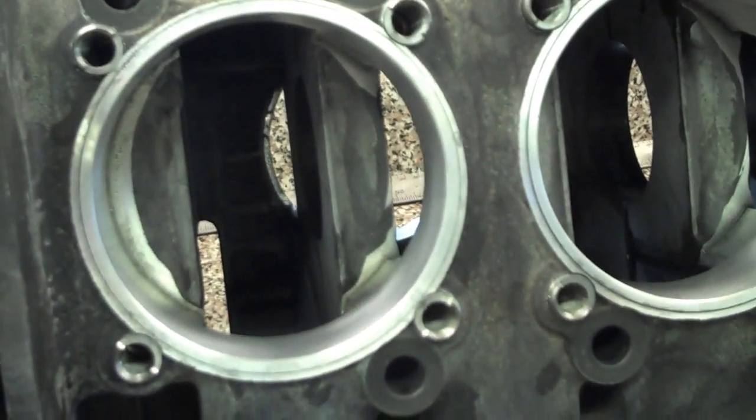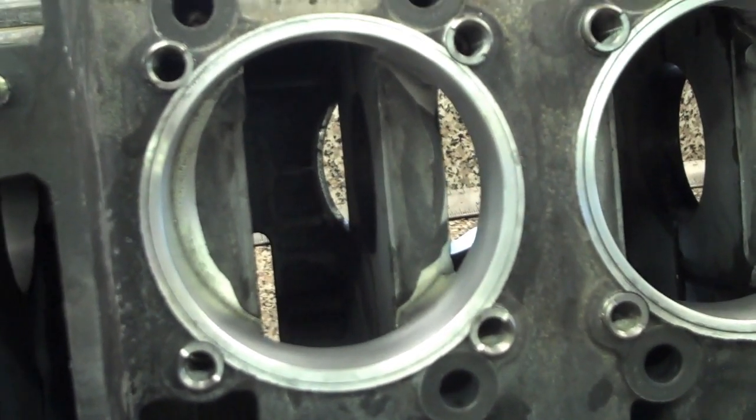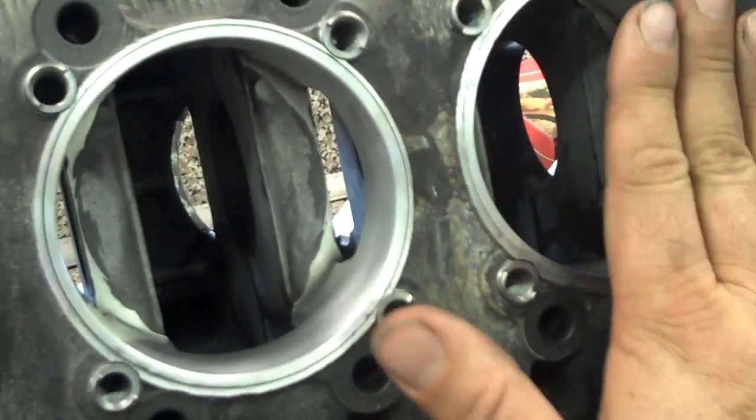So we actually can take, if we wanted, we can even take a 3L aluminum case and sleeve it down to 2 liter if we wanted, with a shorter stroke crank. This case is trued, resurfaced, the detail of the spigot insert, stronger than factory magnesium even.